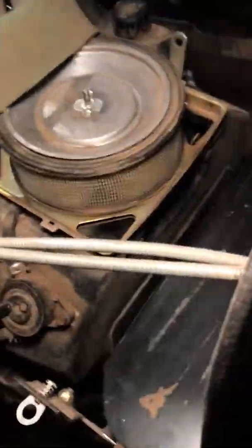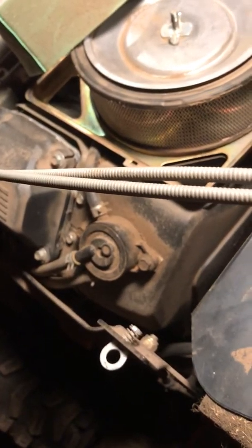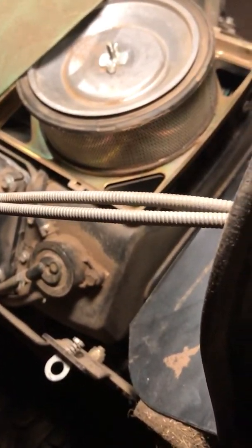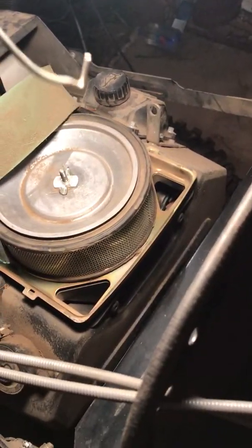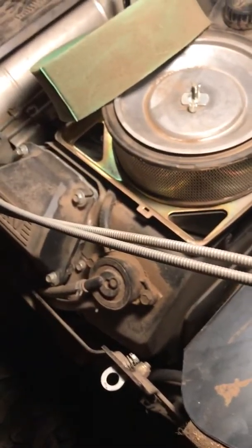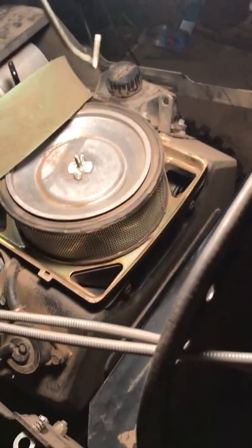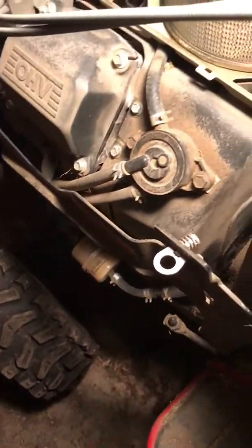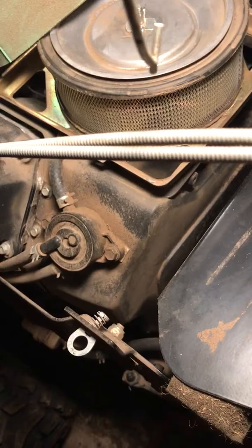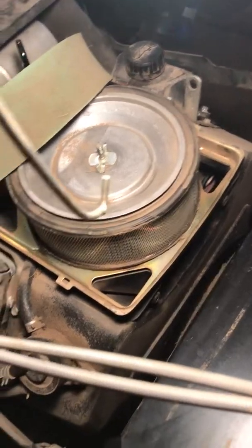on this tractor I gotta try and remove the shrouds so I can clean all the grass off of the fins. This one's a Kohler CH20S air cooled, and it's running a little bit hot. It's done that ever since I got it from a Toro dealer. I won't say their name. Nice people, but I don't know, it might be something wrong with the carburetor actually, instead of clogged fins on the engine, causing it to run a little bit hot.